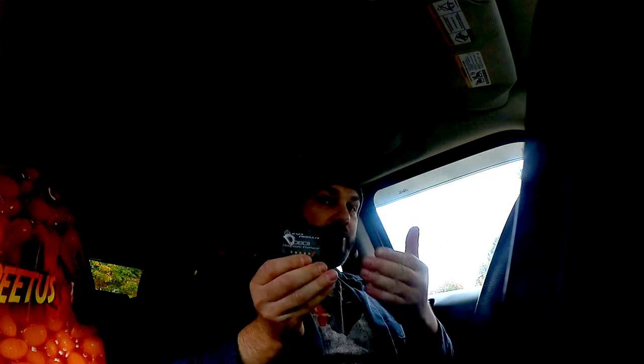Thankfully, fixing it is pretty easy. You need two things: a phone or tablet, and a dongle. The cheapest one I'd recommend is made by BAFX — an OBD2 dongle for around $25, link in the description. The best one I'd recommend is the OBD-Link MX Plus, which is closer to $150. The cheaper one does not work with iOS — if you don't have an Android phone or tablet, you won't be able to use it.